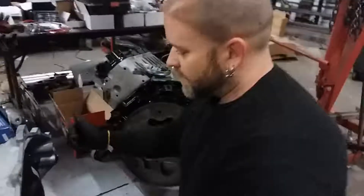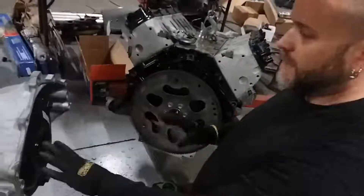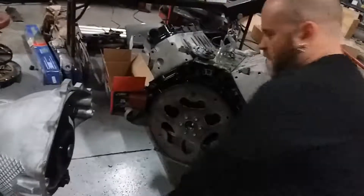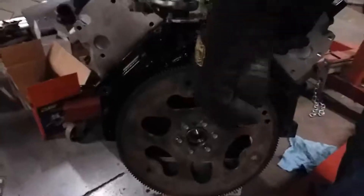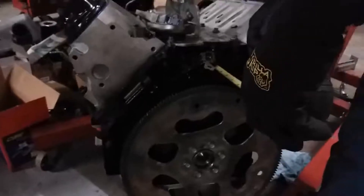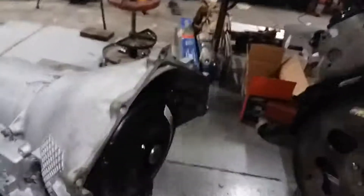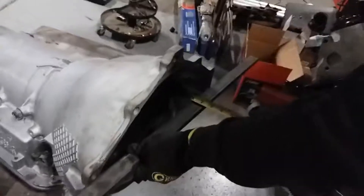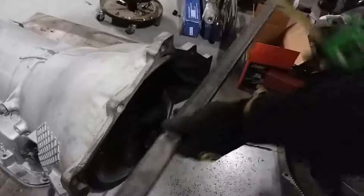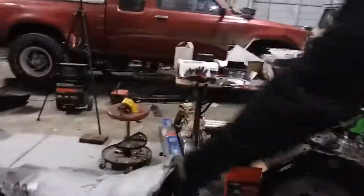The way to really know if you're in place — so you don't spend all that time struggling — you can double check it quickly. Get a measurement from here to here. Take your flywheel: this point, this point, this point — those are your three points of physical mount to your torque converter. The distance from the back of the housing to the face is just slightly over seven-eighths of an inch. Put a straight edge across and you're looking at about 1.03 inches.